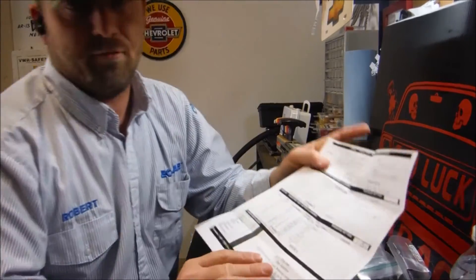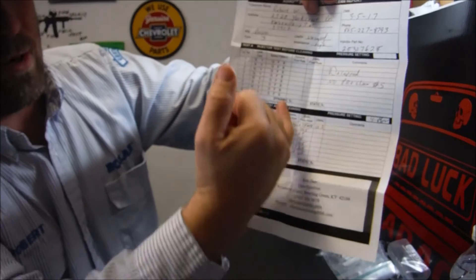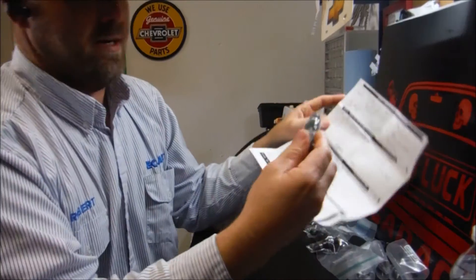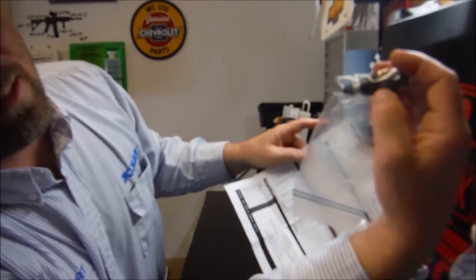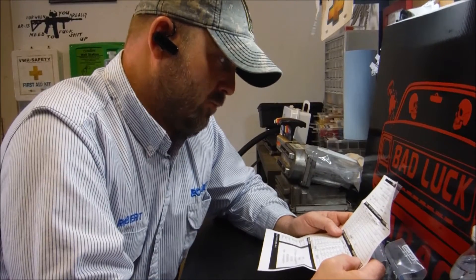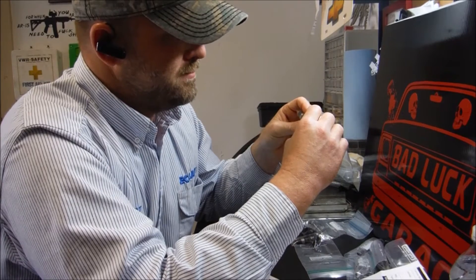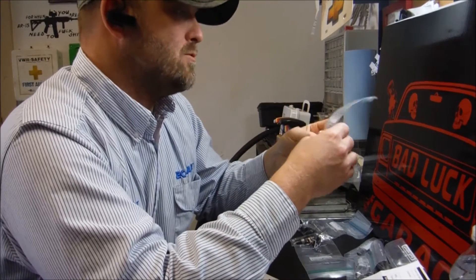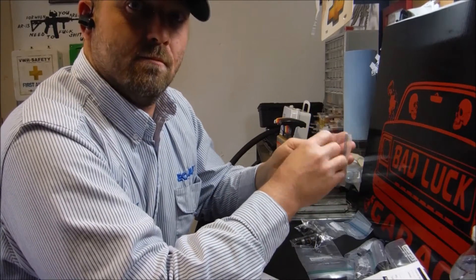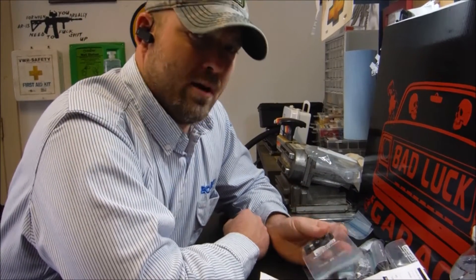I got all my flow numbers here. He does static flow rate and dynamic flow rate, numbers the injectors one through eight, and the number is on the side of the injectors. So we're going to try to get our hands on eight more of these 25317628 injectors, which I believe are the highest flowing injectors on the non-flex-fuel gen three truck engines, because these were rated at 25.2 pounds and all the rest seem to be rated below that — some of them were 22 pounds.